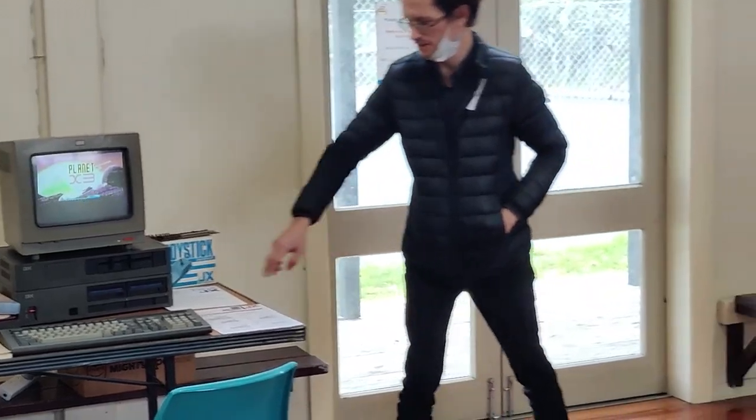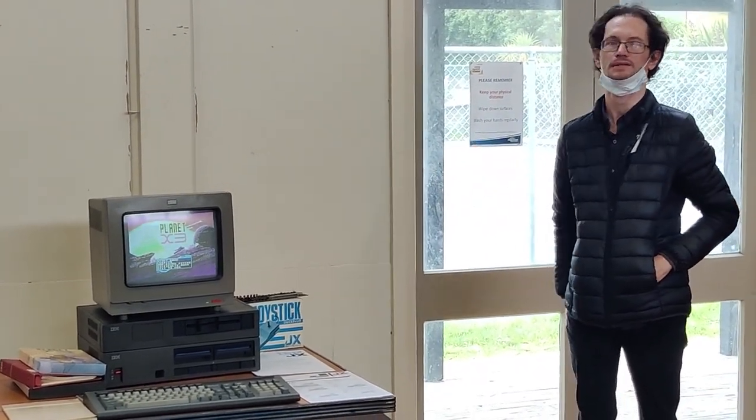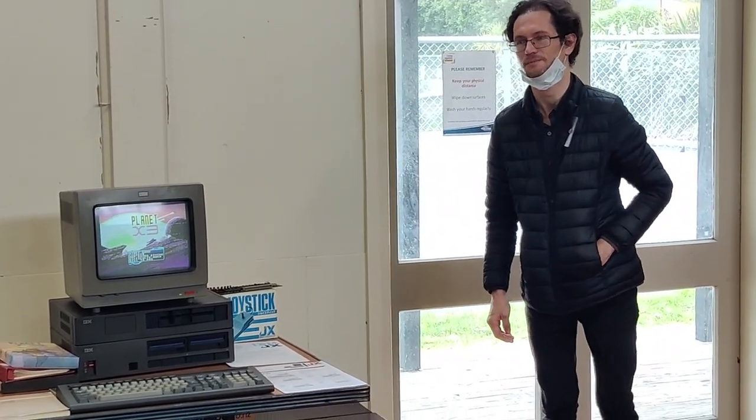The interesting thing was that these are 720K floppy drives. But to not compete with the IBM PC or the PC XT, IBM specifically modified the BIOS to double step the floppy drive, limiting capacity to 360 kilobytes, and it means you can't use a 720K formatted disk in this machine. By about 1986, the IBM PC and PC XT were allowed 720K floppies, so they offered a ROM upgrade for this machine to fix the floppy drive.